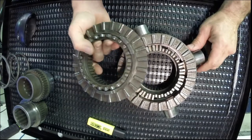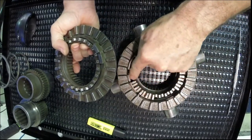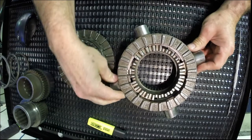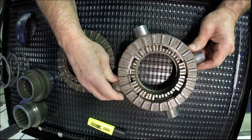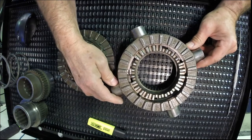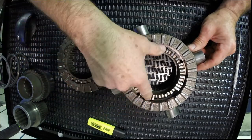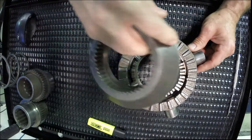So I have my square cut teeth around the outside circumference and my angled mountain peak teeth in the middle. There's another ring inside here. You can see that if I rotate the outer ring just ever so slightly, I move about an eighth of an inch or so. And depending on the operation, as this goes around, one clutch will be able to lift up and separate from the main spider or cross shaft.